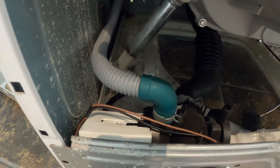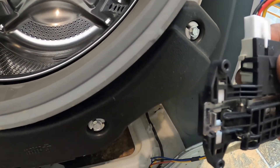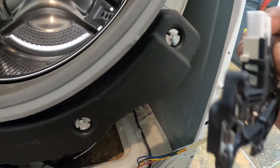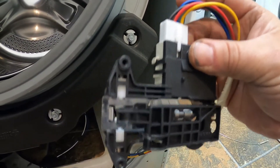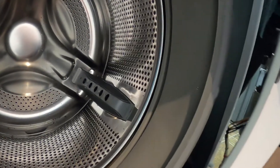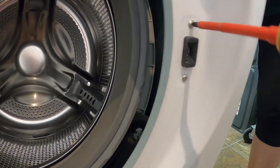We got all the hoses hooked back up again and we're going to put the front cover back on. But don't forget — I talked about the latch mechanism. This latch mechanism screws to the front of the machine. So when you put the front back on, don't forget to hold this while it's still out. You can hold it from the back side and just put the two screws in through the front — it's a very easy job. Some people choose to take the connector off and put the switch back on the door, but it's kind of finicky. This is very easy — just put it back on and put the screws in. If you just hold this back, you can get your hand around in there, hold that switch in, and tighten them back up. Much easier than trying to get the connector on.